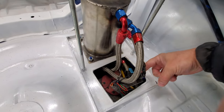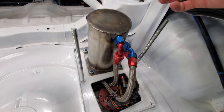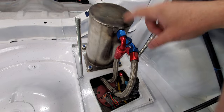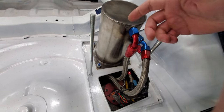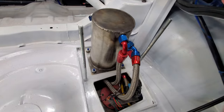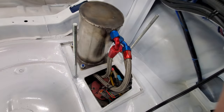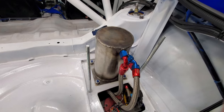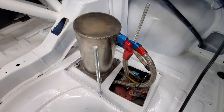So coming out of the fuel tank, the Walbro comes up, feeds into the swirl pot. The swirl pot then fills this guy up, goes out directly through the A1000 — that's what actually creates the pressure side. Once it goes through the fuel rails, the return comes back, and this is actually the return right here. Any fuel that isn't used by the engine gets returned to this tank first. Once this tank is filled, the overflow then comes off of this and goes down into the old return line that was on the tank. Ultimately, trying to keep this guy filled up at all times, if at all possible. Way back when we'd even done some calculations on this — roughly a 600 horsepower car, if I were wide open throttle, how much fuel am I using, how much time am I on a long straightaway? And we ultimately designed it with about 15 or 20 percent worth of headroom in there, so we make sure that we never run it dry. This absolutely solved every single issue that we had with fuel surging.